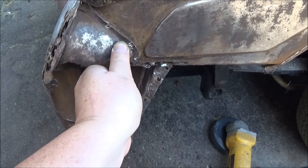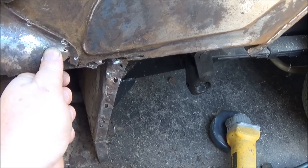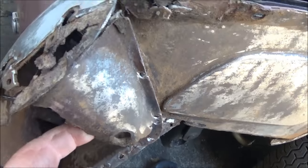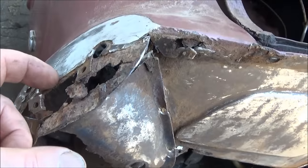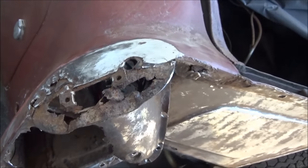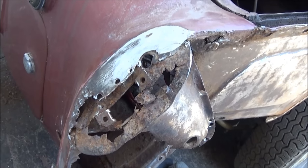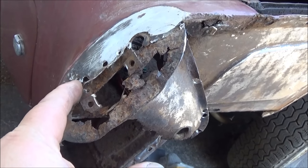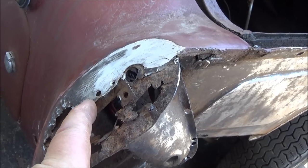We're just trying to carefully take this nacell piece off even though it's pretty rusted. I just sort of drilled the spot welds out and I've been using a cold chisel, going along and tapping to detach that piece. You can see it's moving — it's going to be a bit of a challenge because it's pretty rusty at the top section where it joins onto this top plate. So I think what we're going to try to do is remove this as a unit. I do see a spot weld right there, so that's what we're going to go after first and then move outwards from there, drilling one spot weld at a time and then slowly tapping along and lifting as I go until I find the next one.